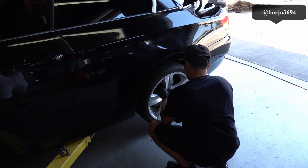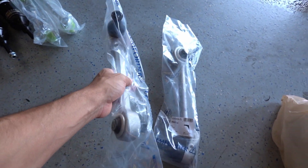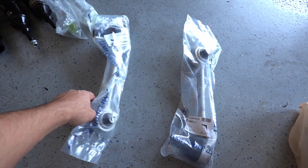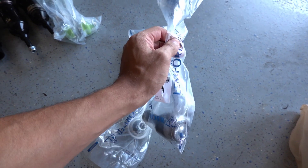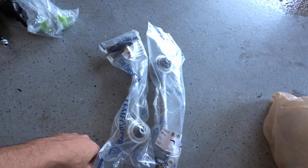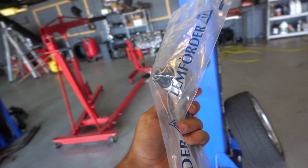Eurocharge Orlando's BMW master tech Angel wasted no time and got straight to work. We're going to be installing new front lower control arms on both sides — the bushings are bad on mine. I ended up buying new bushings before, but then we realized the ball joint was bad as well and they don't sell that separately, so I bought two brand new front lower control arms. But I messed up — I bought the wrong one. I needed the front upper one, which is actually called a tension strut, not a control arm. So we're not going to swap out the arms today, just the coilovers, and I'll order the right parts and install that later.